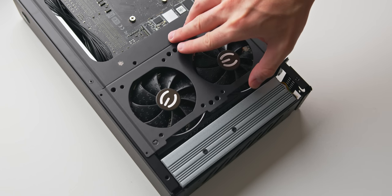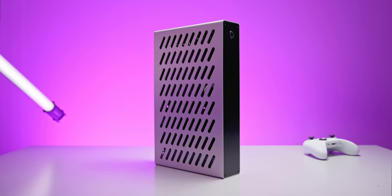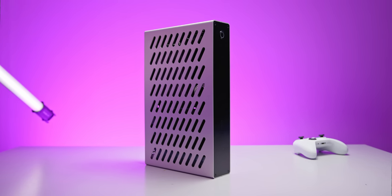If you want to improve this build further with some modding, you can de-shroud the graphics card and mount a pair of slim 92mm Noctua fans directly onto the heatsink — the Skyreach 4 Mini actually comes with a bracket for that, so I might give it a go in the future. This is one of my favorite gaming builds of all time. It worked much better than expected and is well-suited to 1440p gaming. If you have any reason at all to build a gaming PC this small, I'll leave all the parts in the description below.